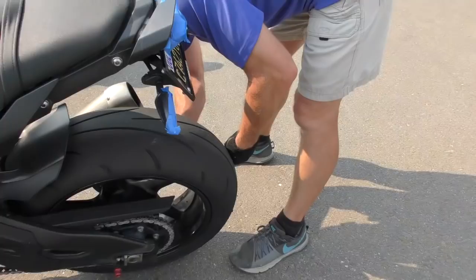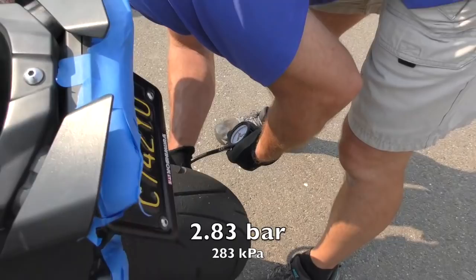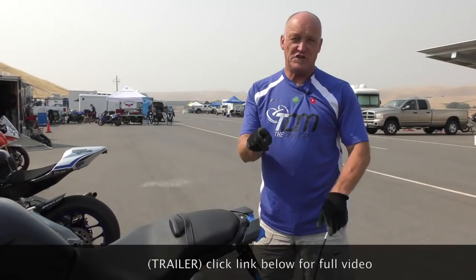He's at 41 in the rear, so we've got to bring that down. Given the nature of the shock and the fact that it's never been serviced, it's going to put a ton of heat into the entire carcass, which will mean a huge gain in pressure.